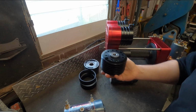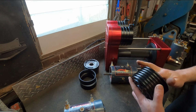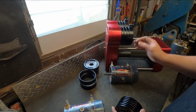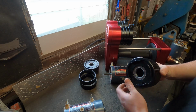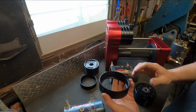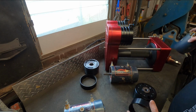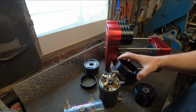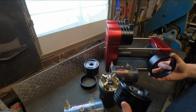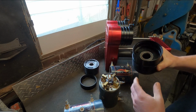What we're doing is adding the WinchGear twin motor adapter. Now these come with an air brake fitted inside. Because we've got to use the air brake off the Redwinch to actually physically attach the motor, we've removed the air brake internals out of these. We're just using them as a straight adapter. And then there's this billet machined adapter ring that allows you to use bullet motors, bow motors, 4.6 horsepower, Warns, all that sort of stuff that lives over the top there to basically extend the adapter around the brushes. That fits beautifully on the back of the adapter.